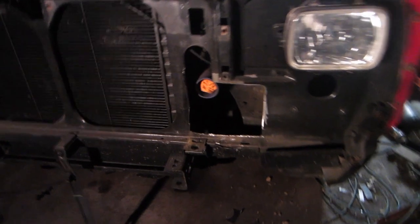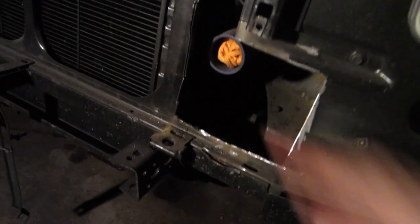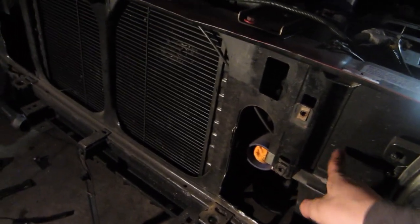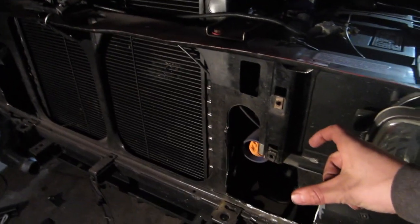For the bottom we just followed the existing line and cut across it, then cut the support brackets off. This support has to come out, and on the other side you'll probably hit the battery tray, so I dropped it down about an inch — this side is about an inch lower, but the intercooler fits in there. I'm going to fit it back in, mark where things need to be, and self-tap them in or tack them up. To hold the intercooler we're going to use all-thread, drill a hole through, put a nut on each side with washers and a rubber bushing.